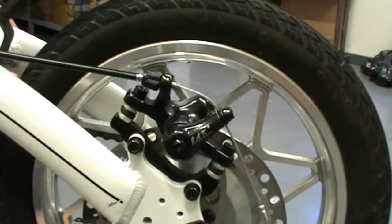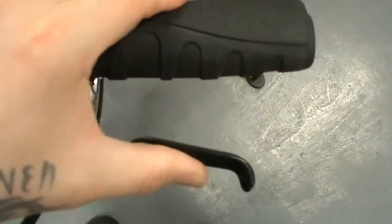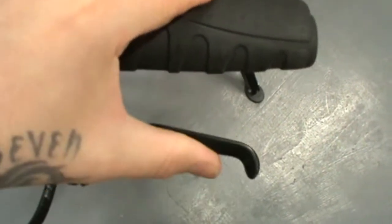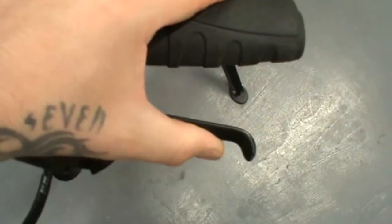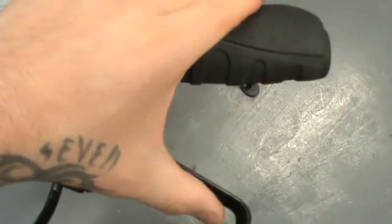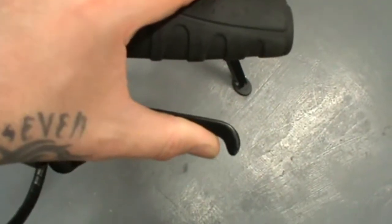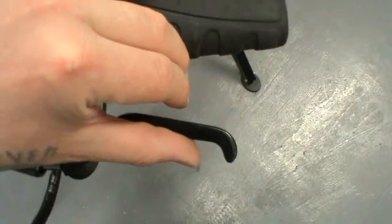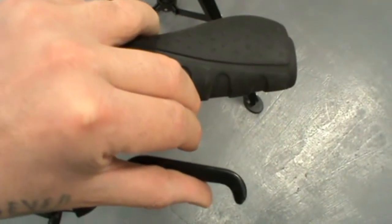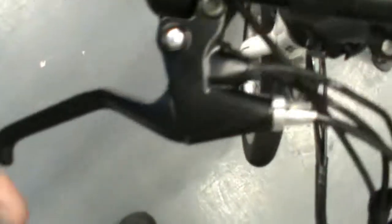I'm just going to go back up and show you what that looks like at the lever. We're well beyond parallel there — there's loads of space. That is as much as that brake needs to be adjusted; any more and it would actually be too tight. The risk is that if you tried to grab a load of brake really fast in an emergency stop, you could end up locking up the wheel. So you want to actually pull and then eventually hit a biting point. That's over two fingers of space — and even just one millimetre on the cable below has brought that out quite a lot.